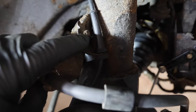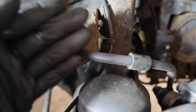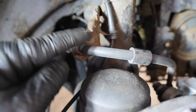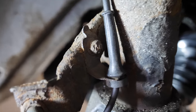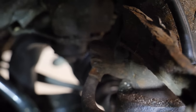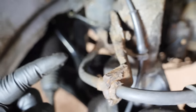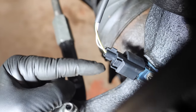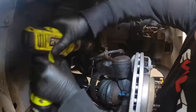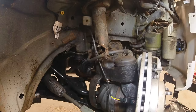If it's in the brackets provided by Ford, there's not really that much room. I can't bend this bracket to give it more clearance to the left because that puts extra strain on the brake pipe. So my plan is to get this little bracket off — it looks really rusted — and put it on the other side so the holder runs straight down into the ABS sensor, giving it a bit more play. After a good cleanup and a bit of WD-40, it wasn't that bad, and my plan actually worked.